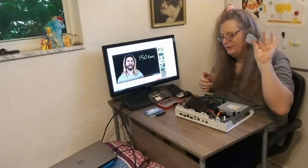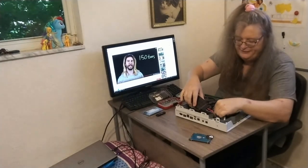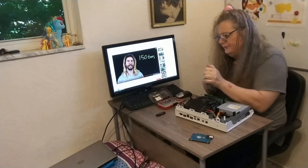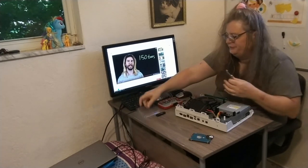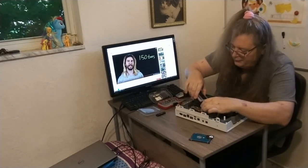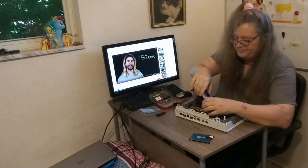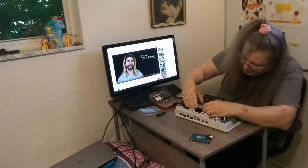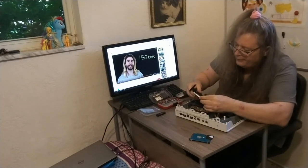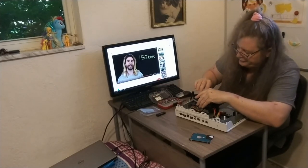So here's our old mechanical 2.5-inch drive. If you want to, you can disconnect the SATA cable and the power cable here, but I didn't really need to. Now, here's the solid state drive that we formatted using the special script and that interesting proprietary formatting, right? What I want to do is line up the connectors on the drive and the connector in this case, and make sure that you orient things correctly. Then I take this drive and clip it in, line up the screws, and screw the new drive in where the old drive was. So I will put those screws back now.